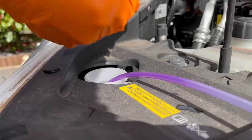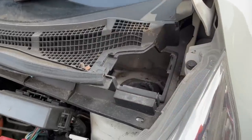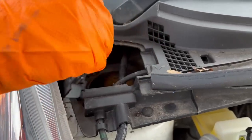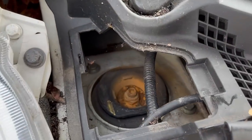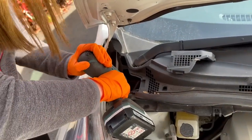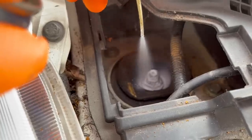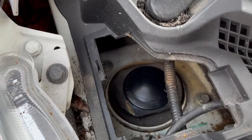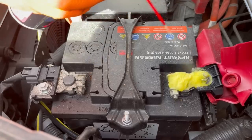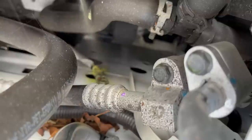Next is the screen wash which we use a tablet additive for and they work really well. The Leaf does have a flawed design which is the same on their latest 2022 model — the driver's wiper spindle drops water directly onto the offside strut top and causes it to rust as seen here. A quick clean up with a wire brush makes it look a whole lot better. Add some PTFE spray and a strut top cover and the issue is completely resolved. We also add battery terminal spray protector to the negative and positive and earth points around the engine bay.